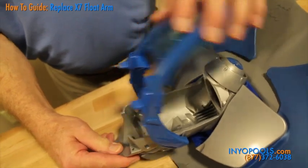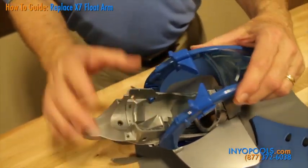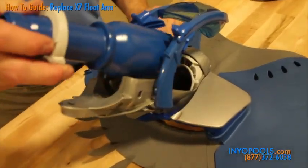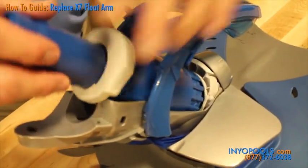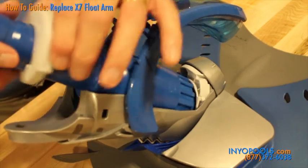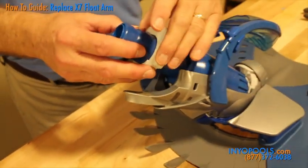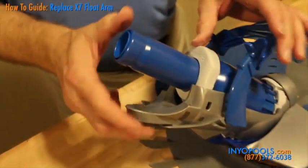Move the handle up to the halfway position to ensure that the posts are fully engaged. Angle the new engine assembly into the bay of the lower body assembly. The thrust washer should be behind the retainer with the widest part of the washer on top. Push down on the end of the engine assembly until it clicks into the lower body assembly.